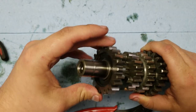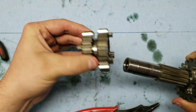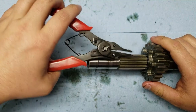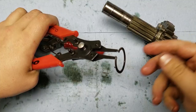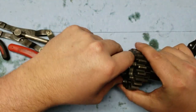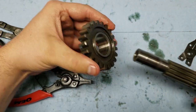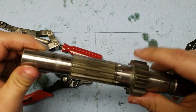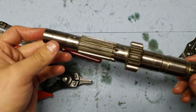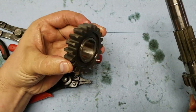Moving along, we got the fourth pinion gear — just slides off the shaft just like that. Then you have the second and third pinion gear — just slides off the shaft as well. And you have a circlip on there, this one actually has the holes in it — just using snap ring pliers to get that off. Set that off to the side. Now we have a tooth washer on here. Then the fifth pinion gear just slides off there just like that. And then this gear is made to the shaft so it's not going to come off. That's the whole main axle disassembled.